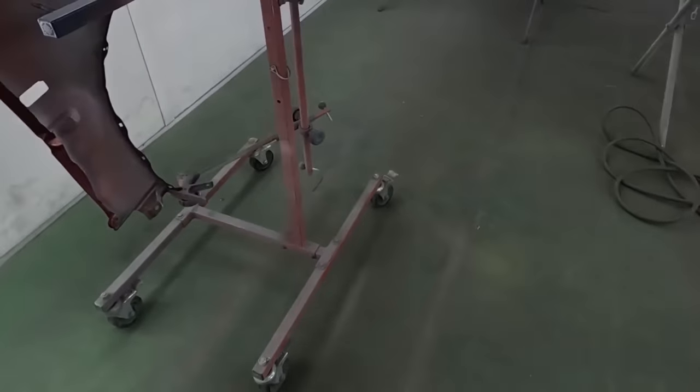We didn't have to sand it down and start again, so I'm happy with that. But reds do take a while to cover, and we wanted to make sure we had full coverage, and that's just what we have here. So let's go ahead and mix up that red tint, that bloody red top coat that's gonna give it that beautiful candy appearance. And then from there, we'll go ahead and clear coat it. But I'm liking the way that this looks so far.